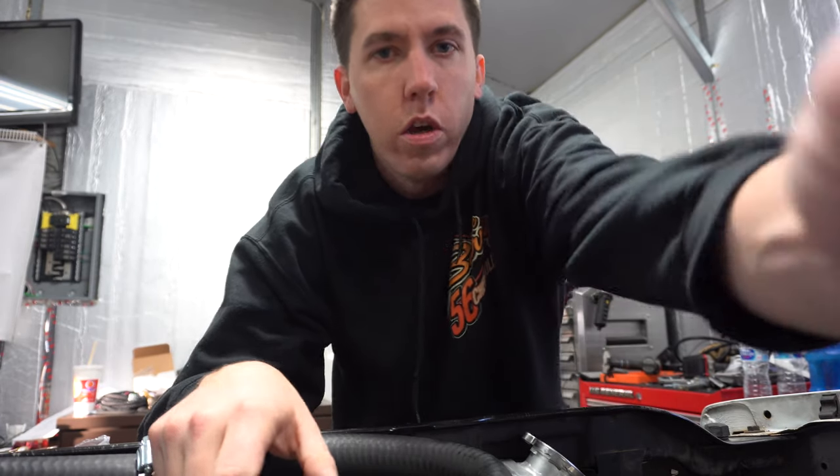It'll probably take me a few days — it's Friday night right now. I'll probably go through the weekend wiring this truck, just making sure I'm going to build a relay panel and an ignition panel for this truck and wire everything separate so it is all standalone. Hopefully the headlights, tail lights and all that stuff work with the factory harness. I got a few more parts in — go ahead and show you those now.